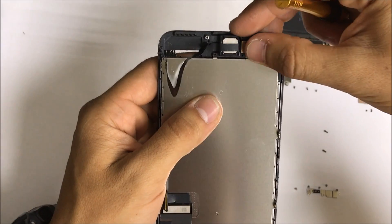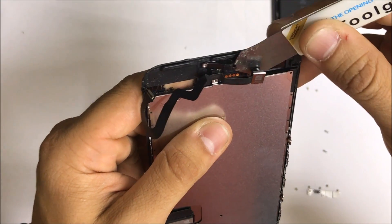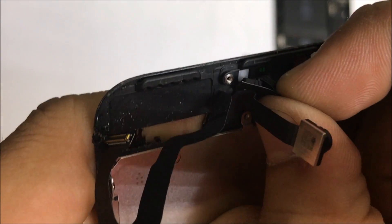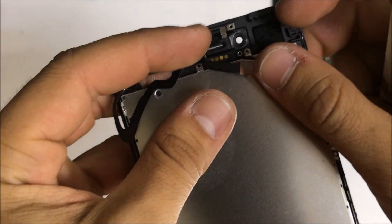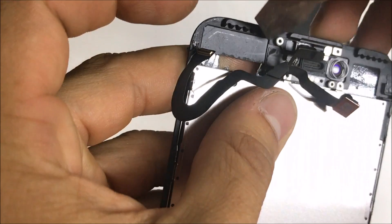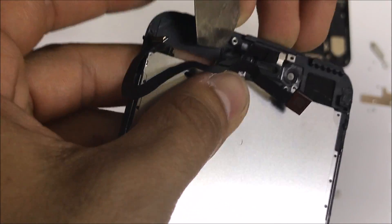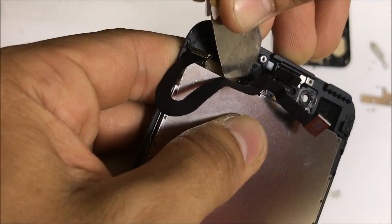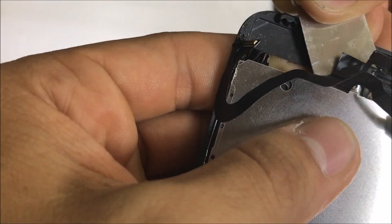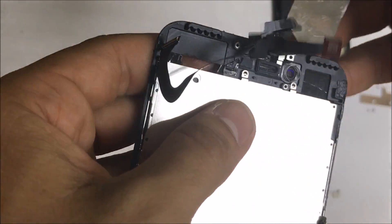Let's remove the bracket. Now we're going to lift up on the front camera, remove the ear speaker, and gently pry up on the cables with a thin tool to lift it up carefully. Make sure you don't pull on it too hard — you don't want to break it since it is glued down with some adhesive. We're going to pull gently, using the thin prying tool again to get under it and lift up in between the flex cables and the frame, wedging carefully around until most of it is removed. And it came out completely — let's put that to the side.